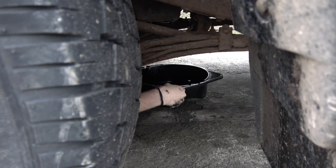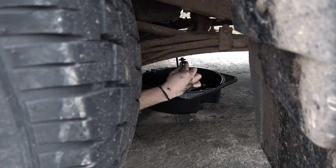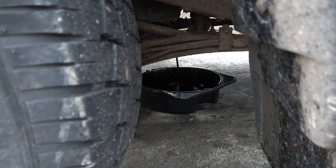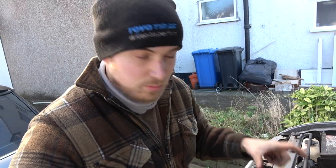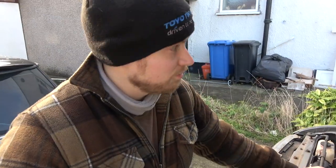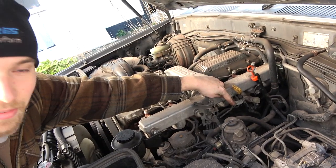Drop the oil time. It takes quite a lot of oil — I hope my little tub thing is big enough to catch it all. The oil's drained. I've had to use three different buckets but they're all drained now into one big tub. I've put the new oil filter on — the old one came off quite easily, not even done hand tight, which is perfect. So I've done the same, just tightened it a little bit more than hand tight this time.